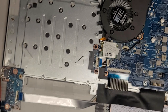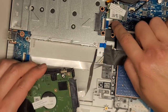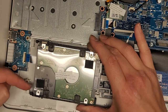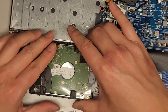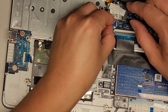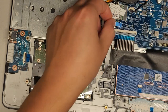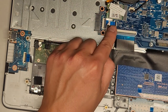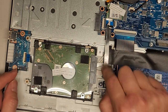We got the hard drive. It goes in this slot down here — make sure the connector latches up. Get the back side in first, going at an angle, slide it back, and then push this down. Then plug in the hard drive cable connector — you can see the little white parts behind the wings of the blue connector. Latch that down.